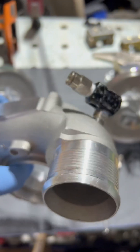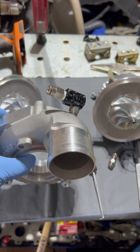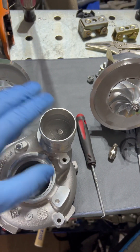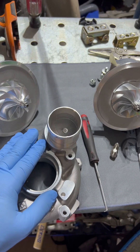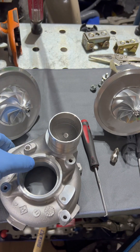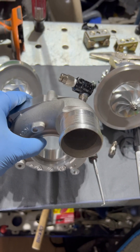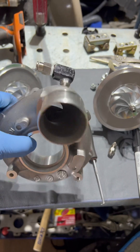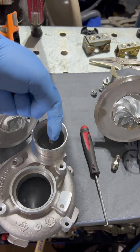That's the nozzle. The reason I'm doing this is because one of my MAP sensors got melted — it's very high temp after the compressor wheel, before the throttle body and after the throttle body. So I'm gonna put small nozzles on each turbo, and I'm trying to angle them with the flow because I hate spraying into the wall.